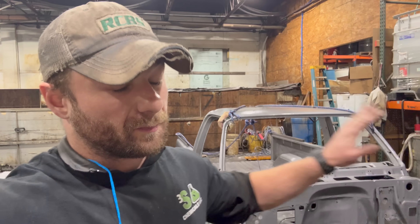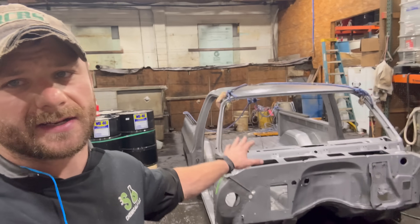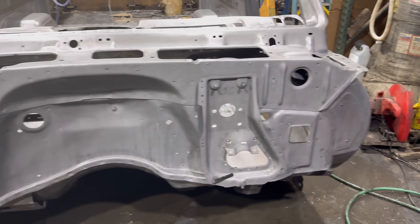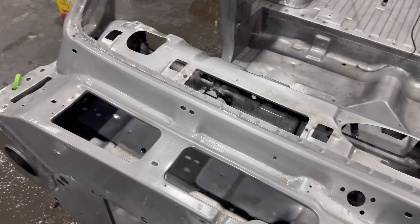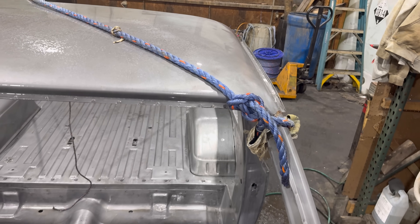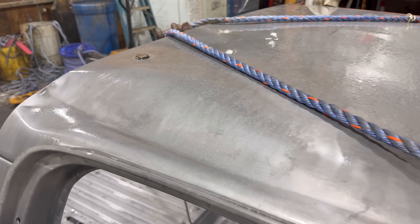The Blazer is all finished and down to bare metal — this thing is looking absolutely amazing. Pretty sure this is the only Blazer I've ever had, but it's one of the best I've seen. The paint wasn't too tough on this thing; it actually surprised me. It did take two or three dips, but we got this thing down to bare metal. There wasn't really a lot of rust to deal with — two dips in the acid and that was about it. This thing looks so sick in bare metal. Starting at the front, you can see everything's basically perfect. I just pulled this thing out of the rust inhibitor, so you can see we still have some fluid on it. We have some pitting in the roof — that was about the extent of the rust — and we had a little bit in the bed.